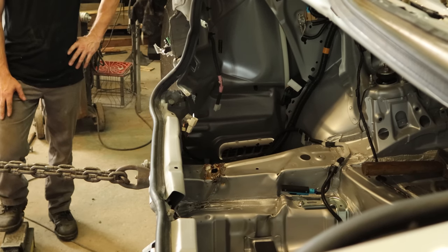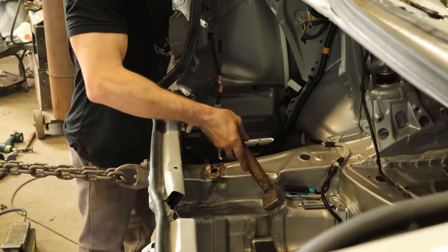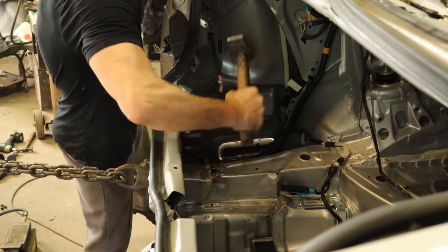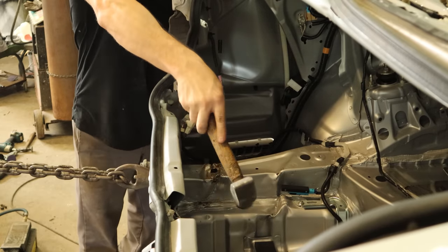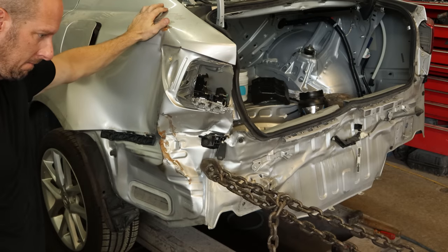There's a better angle of what we're trying to do. We're getting to the end of the strength of those bolts and we still have quite a kink in our rail. We're going to have to redirect our efforts — even our stress relieving isn't moving much anymore. That rail is pretty tough; it's not even high strength steel. So we're just going to go do something else.